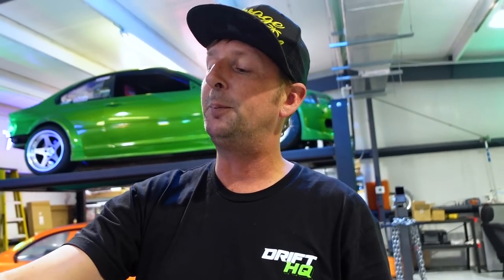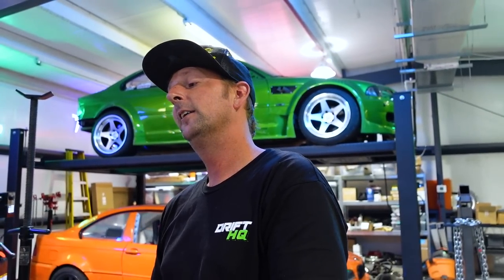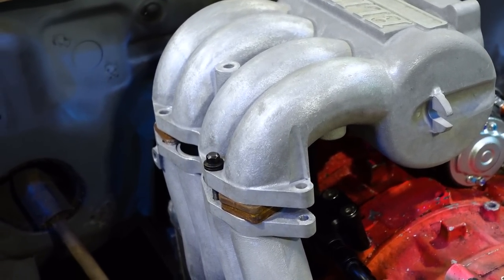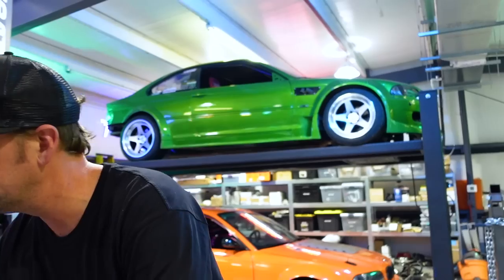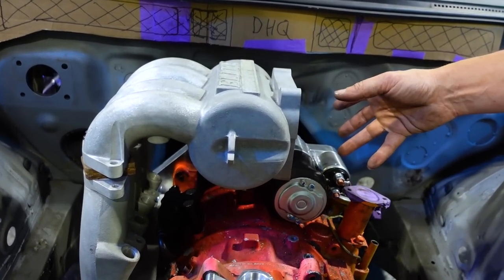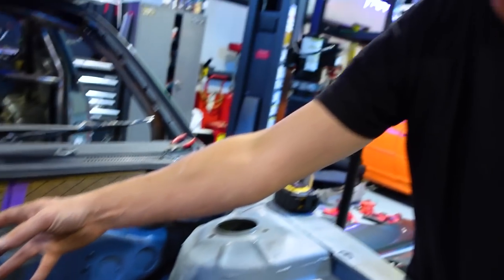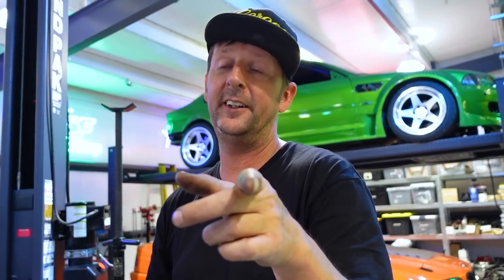We don't have our spacer in for our intake manifold, but they told us it's a 5/8 spacer. So I stuck 5/8 inch plates of steel together and bolted it down. So now we can see our clearance for our starter. We're waiting on the electronic throttle body to come through, or the drive-by-wire throttle body for this. We have to order things to make a manifold. That hasn't been gone over anywhere either yet.